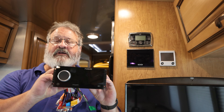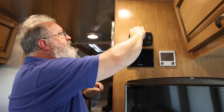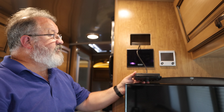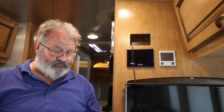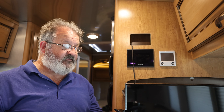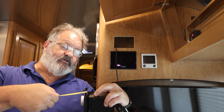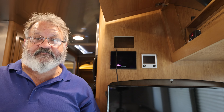I've done a little experimenting. To remove this — this is just the control head, not the actual stereo. The actual stereo is up inside here, but the Garmin is going to mount in this hole. From the mounting plate to the wall I have four and a half inches, and on the Garmin that will give me plenty of room for the cabling before it hits the back of the access wall. Where the cabinet door closes we have just slightly less than an inch. Measuring from the back through the front of the knob, it should just clear — maybe not with the cover on, but the cabinet should clear.